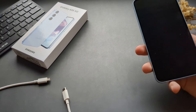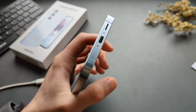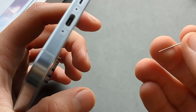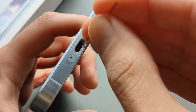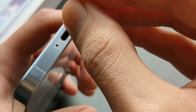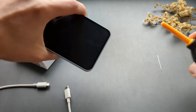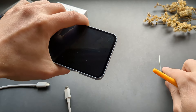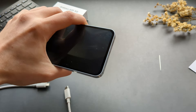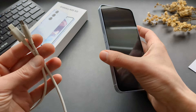Make sure you power off your phone before doing this — it's obviously a metal object and it can cause a short circuit and damage other things. So be extra careful. Place the needle inside and scoop along only that outer edge, repeat this several times, then shake it out. While doing this with the needle, also use the air blower or brush to clear debris, and repeat the needle and blower steps several times. That's how you clean the port.